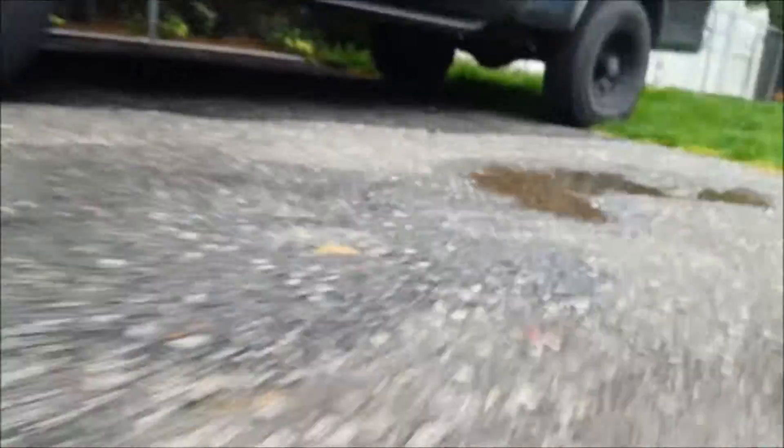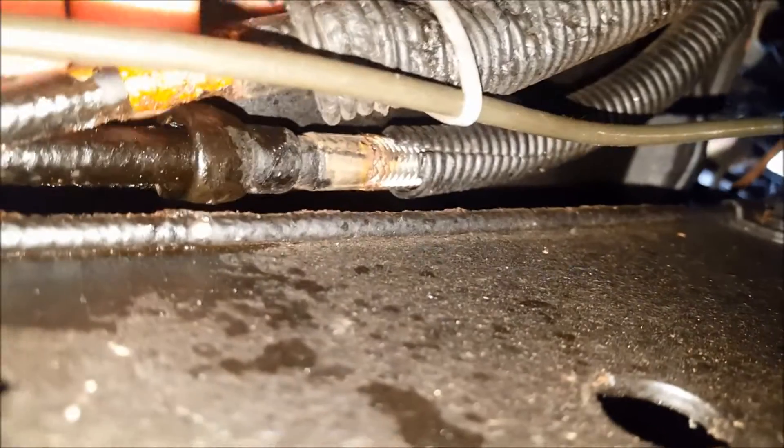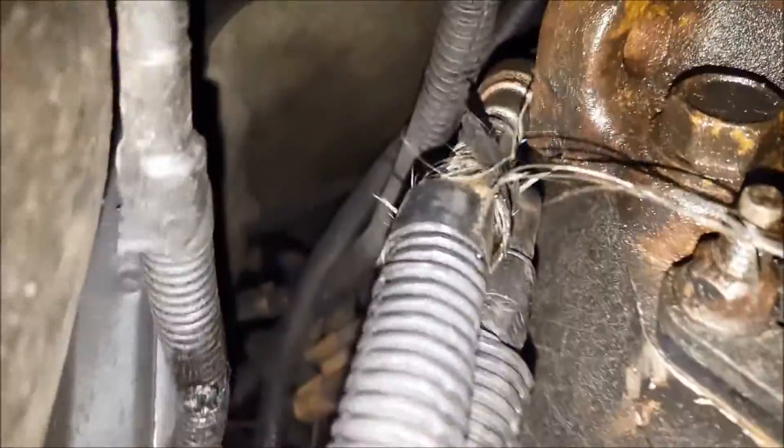What you're going to do is roll onto the truck. I sprayed these down with some rust penetrant, because I'm going to be taking those off at some point. This smaller line here is your fuel return; the bigger line is your fuel supply. You've got two stainless braided hoses here, and then they go up to two hard lines, and above that they connect to the rubber lines I was talking about kinking off.